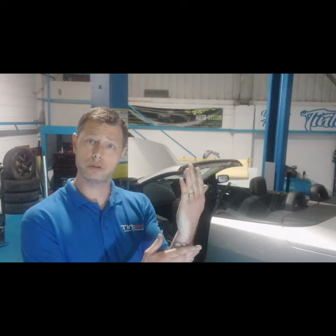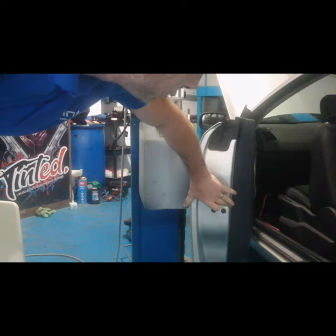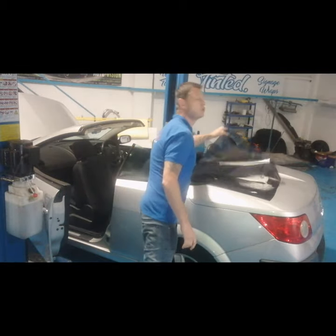Now if this is a window that goes up and down when you shut the door — when you shut the door the window goes up, and when you open the door it comes down — what we want to do is come over to this hatch here and double press it: press once, press twice. That will cause this window to go up. Now this particular window doesn't do that, but that's what to do when it does. The reason is you want to push that button in and trick the car into thinking the door is closed, because normally when you shut the door it hits that button and the window goes up.